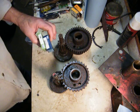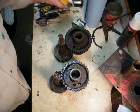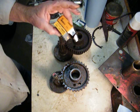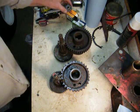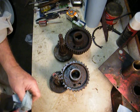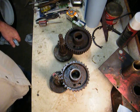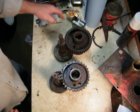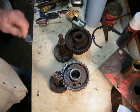So again, you got the B1212 for the needle bearing with a 7410 seal, or you can do the S8K with the 741643 Timken bearing and seal. And that's this bearing right here, so yeah. Pretty easy, but that's what happened with these things, and you got to know what you got when you tear it apart before you order parts. And again, these will interchange whether you have the needle bearing or the ball bearing style in the side plate. The other bottom part of the bearing is this. It's just the needle bearing or the ball bearing that fits on the shaft coming out. And it's a strength issue, but that's what's going on.